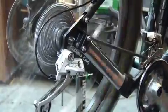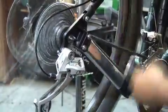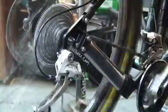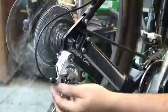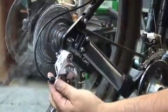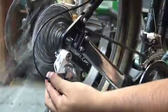To do this, we're going to either turn the barrel adjustment counter-clockwise or clockwise. Let's put the chain in the middle gear to show you what happens when you make that adjustment with the barrel. If you turn it counter-clockwise, you will see you're going to jump up the gear.